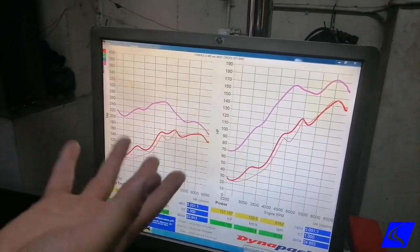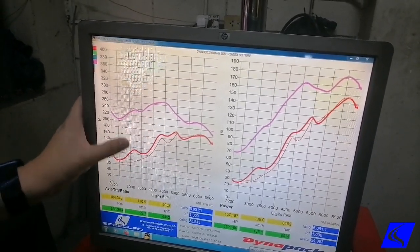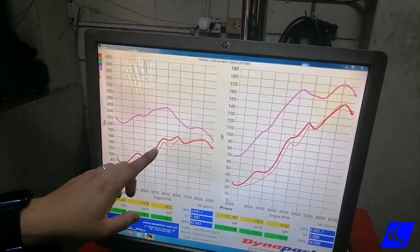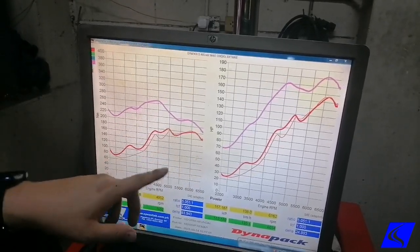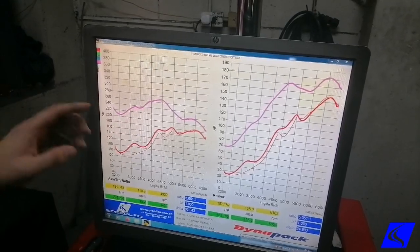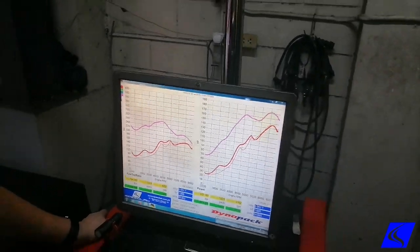Torque similarly — any gain in horsepower gives you a gain in torque. We went from 100 Nm to 220 Nm at 2,200 RPM — we doubled the torque right there. From 110 to 220, 100 to 240, 140 to 260 Nm. Peak torque now happens a little bit earlier — it used to be at 5,000 RPM, now it's at 4,500 RPM. But more importantly, you already have 220 Nm at 2,200 RPM, as opposed to the stock peak torque of 180 Nm at 5,000 RPM. The owner will be very happy with this one.